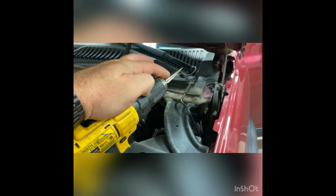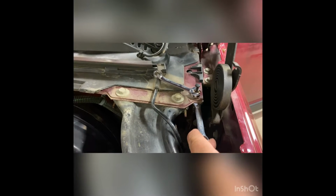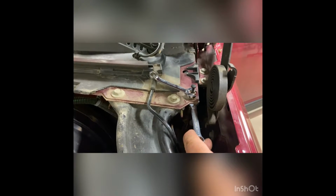anything else. And then just above the brake switch, we've got our white brake signal wire. It's exposed and ready to be connected to. And then of course we need to drill the hole under hood where we're gonna install our hood pin. And for that, I'm gonna be using a 1/2-inch step bit to drill that hole. Once our hood pin drops into the hole we've now drilled, with a 12 mil wrench on the bottom and a 7/16 inch wrench on the top, we can tighten it down snug so that it's not gonna come loose.